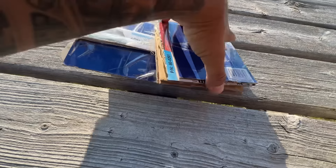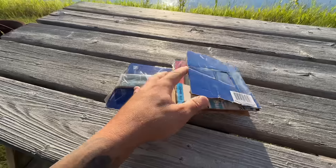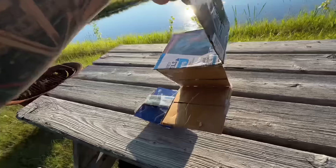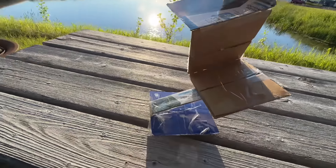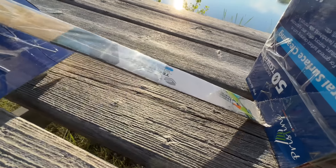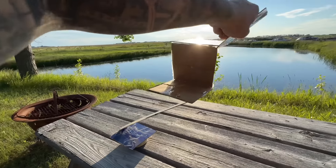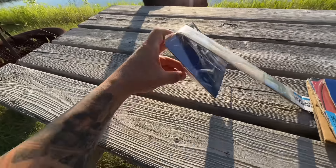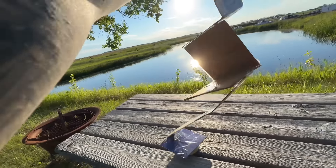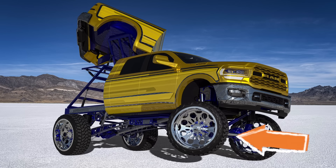Here's the completed Z-Rack — as you can see, it looks like a Z. How this actually works: imagine the cab of the truck is here, the box is here. The box tilts back and then up one stage, up another stage, and then all of a sudden the box is way up here. Down here is the crane, and this crane actually slides that single stage to the end. So when it's set up, it's going to look like the box is floating there. Under here is the bearing, so all of this will extend out and then also pivot. Which means we can put it far out to one corner, get all the weight distributed back there, and get that front wheel in the air.